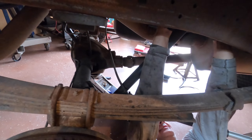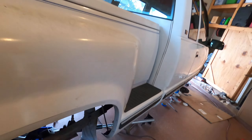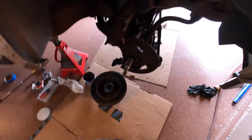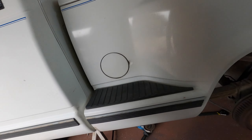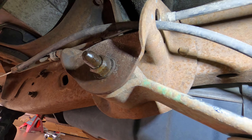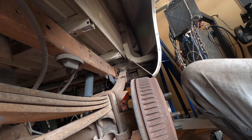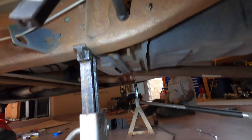It's all part of the hobby. Mike's removing the rear shocks; I've already been grinding rivets on the fronts. We forgot the rear bearing seals, so Mike's wife was nice enough to run and pick those up so we don't sling grease everywhere. The front will be done, and on the back I'm grinding rivets — I need to grind those two rivets, take out the spray-in bed liner, then replace the brackets and shackles in the back. We'll replace the short shackles with longer shackles to lower the truck — that is going to be done today.